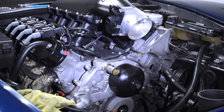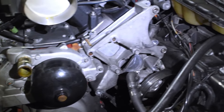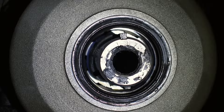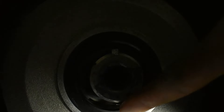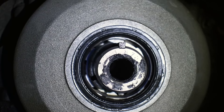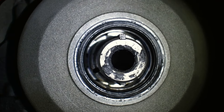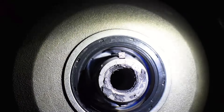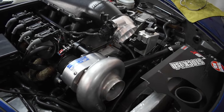Halftime check-in: we've got all the components from the ProCharger removed - just took the crank pulley off, so now I'm ready to start installing the A&A stuff. The Magnum crank comes double-notched - one up here and one down here - so I'm going to have to take my time and file that other side for the notch on the Innovators West dampener. I had to do the same thing with the ATI. I just add a little bit of RTV to make sure oil doesn't seep out past those notches and we're good to go.